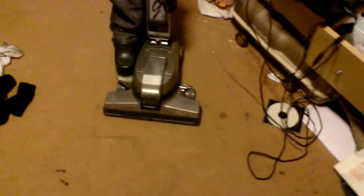The thing is, with my G4, when you turn it on it makes a funny noise. I found out what was going on. I did take it apart just the other day — took the thing completely apart and spun the shaft with my hand. What it's doing is the shaft is actually spinning inside the motor. So I'm going to pull the suction fan off the G4 and put the original G4 fan on this. Hopefully it'll run a little better and not make that funny noise.